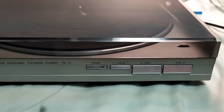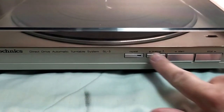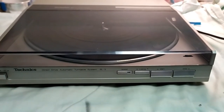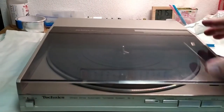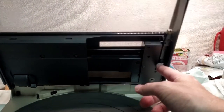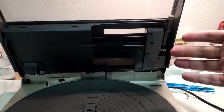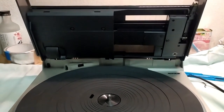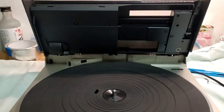We can stick it up for sale. The power on/off polished up nicely, but these were just so pitted and bad — it was disgusting. The adjustment screw is back there if you've got a little trouble with starting and stopping. There's also a screw here you can adjust for setting this distance, which I think mostly affects your end performance. If you've got the service manual plus these videos, you're going to be okay tackling one of these — provided you've got a bit of finesse about it. Just be careful, and that's where we'll wrap this up.